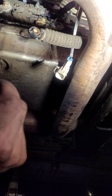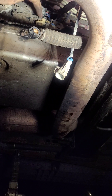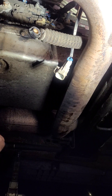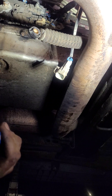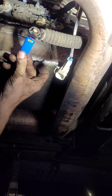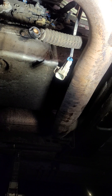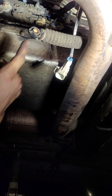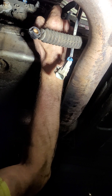I'm going to show you a little trick here. This is a 2002 Yukon — my 99 Silverado is the same way. These two plugs on the neutral safety switch, when you're trying to unplug them, a lot of times you'll break them because they actually have some kind of adhesive on them. You just got to heat it up a little bit. Obviously the lighter is not the correct way — a heat gun would be better — but if you don't heat the adhesive up, you'll end up breaking the plug trying to get it out.